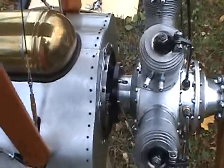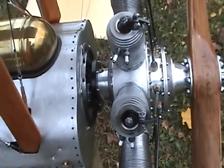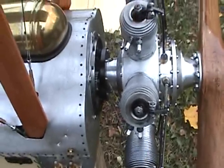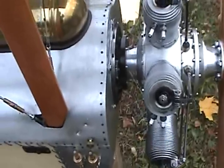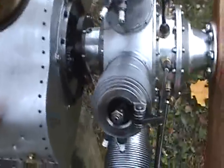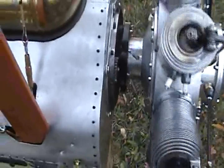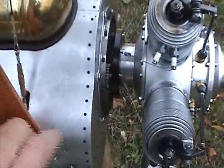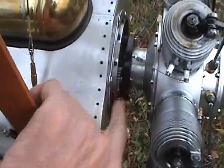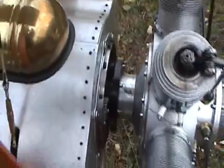Even though it's a hollow crankshaft, there's very little vacuum on the crankshaft. The spark wires are bare. These spark plugs are from NAPCO, quarter 32. This is the V3 plugs. The bare wires go down to a distributor which of course rotates with the engine. There's a fixed brush up near the top. This gear here happens to be a timing gear for the ignition. On the opposite side there's a gear also for the oil pump.